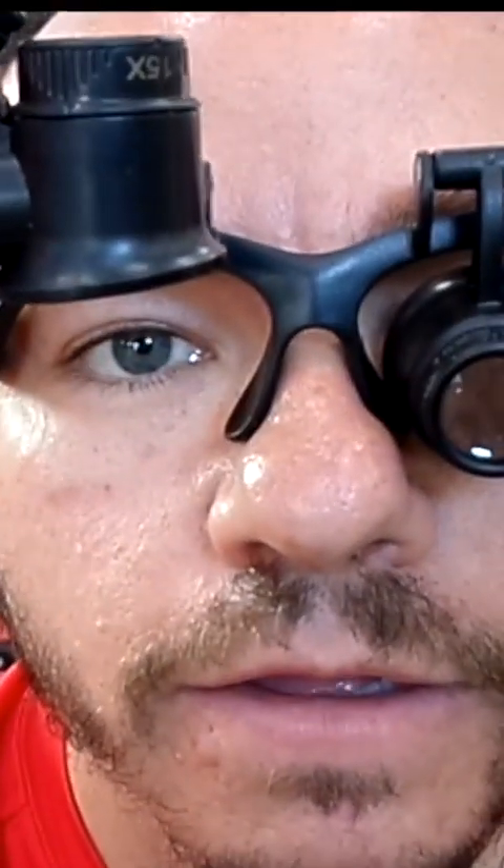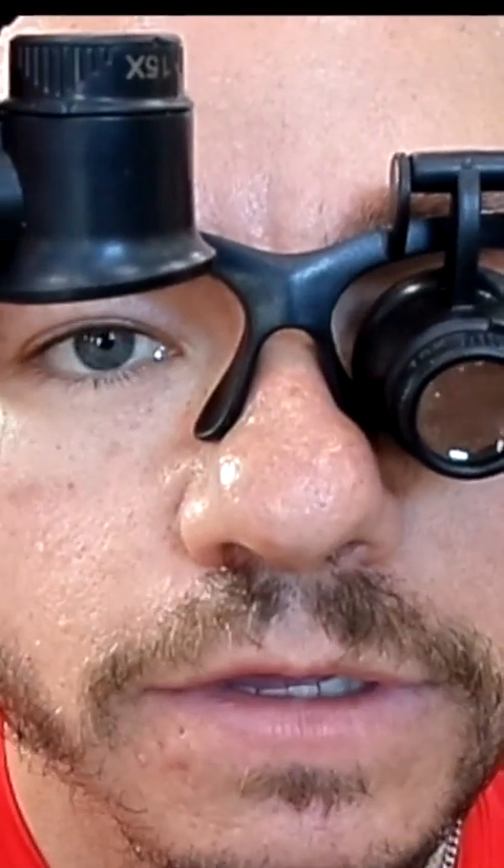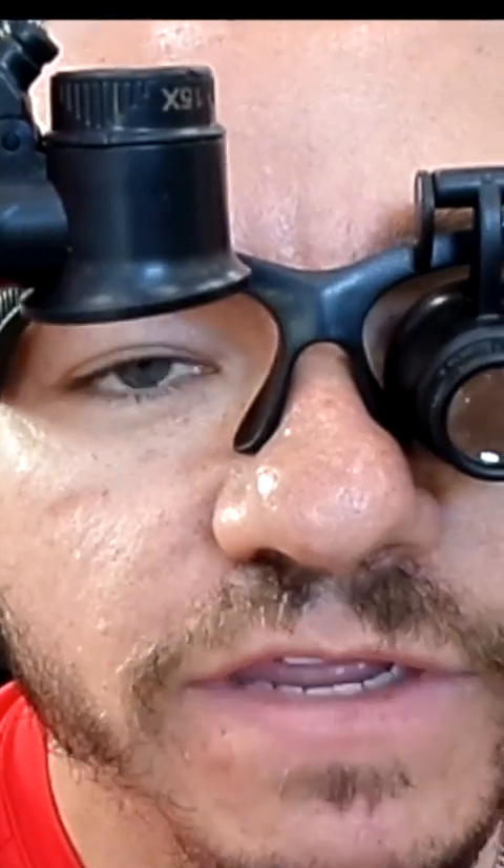You can see I'm wearing some special jeweler's lenses — I've got my 15x zoom lens on. This allows me to see up close to the vehicle far better than what you can with the naked eye. And we're going to slowly, methodically put the paint into that scratch one dot at a time.